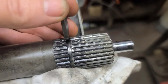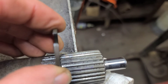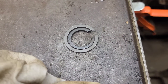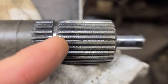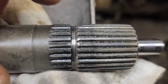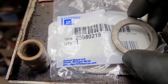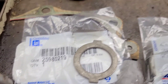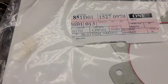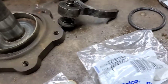See, this is the type of snap ring I think would be better - a nice square snap ring like that instead of round. Obviously you can remove and replace the axle seal by pulling this whole assembly off. I found these two snap rings in some used parts I had - this one's too big and the other one's too small - so I'm going to see if I can find one of that style. Here's the part number for the thrust washer inside the case: 25980219. The axle seal is 22761722 from GM, and the cover gasket is 15270970. I'm going to replace that gasket as well.